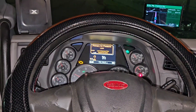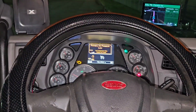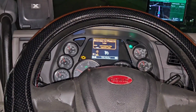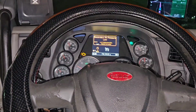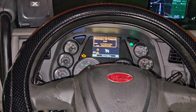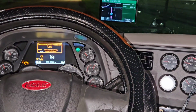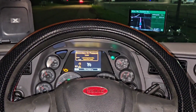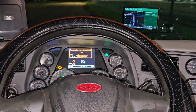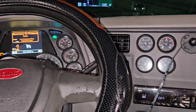If you're trying to do that with air in the system, if you're working anywhere with your feet around the tires, anything up under the truck, you just shouldn't do it, because you already know that the truck is going to lose air and the body is going to settle. That means everything is going to go down. The cab is going to go down. So the cab airbags will be deflated. The rear airbags on the frame, those are going to deplete. Everything. So for your own safety, just take all of the air out to begin with. It's all interconnected, so it'd be silly for you to think that you could change something like that and work the system somehow, beat the system.